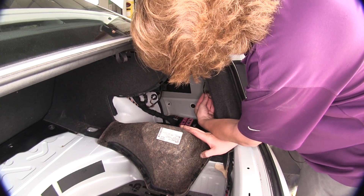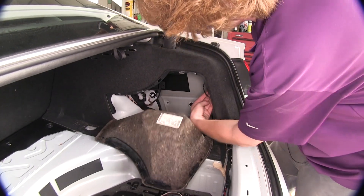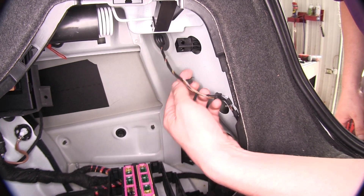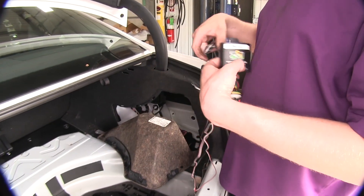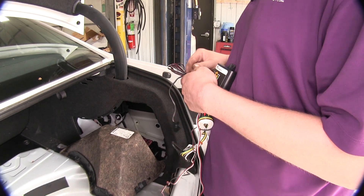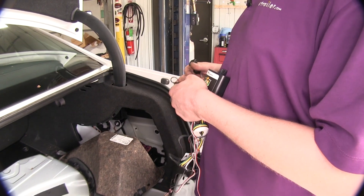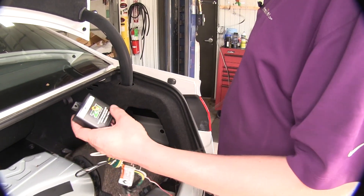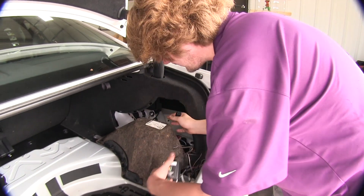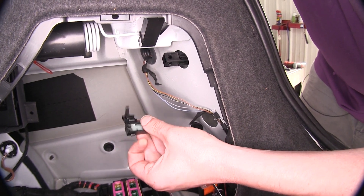Our passenger wiring is going to be located right here. We'll need to take a razor knife and cut off some of that sheathing so we can separate out those wires. Now we can peel that back. We'll get our wiring harness out, untangle our wiring, and separate out the ends. We want to get our wire labeled for the passenger side, which is the right turn signal. Once you've separated out the right turn signal wire, we're going to clip this around the gray and blue wire with the arrow pointing towards the bulb.